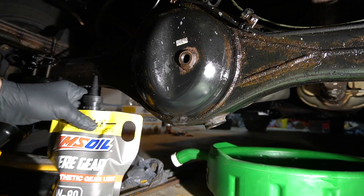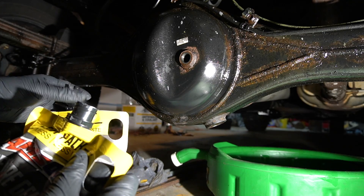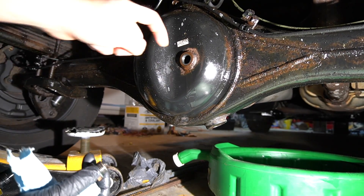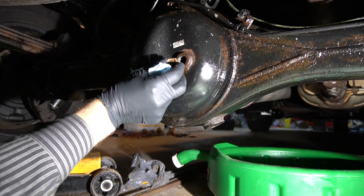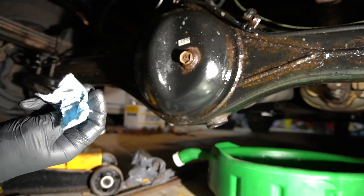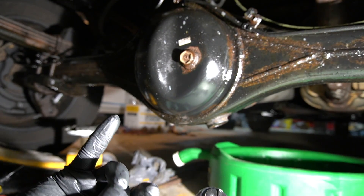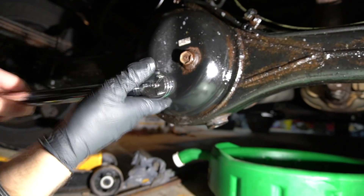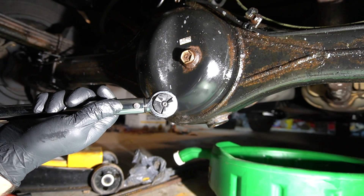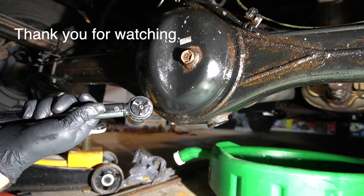Now I'm going to take this off, put the cap on. I've already removed the seal. I have added 4.9 quarts. Now I'm going to put the fill plug back on and torque it to 36 foot-pounds. I'm going to wipe everything clean. The wet stuff you see is not gear oil — it's actually undercoating I applied in the fall. In winter time, gear oil flows much slower. Make sure the torque wrench clicks. Don't forget to subscribe to my channel and share this video. If you have questions, ask — otherwise, have an awesome day.